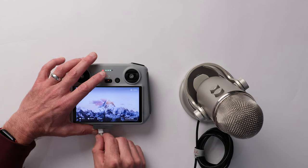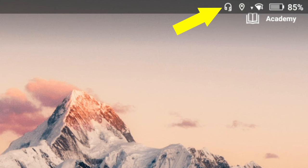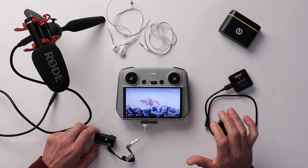The RC remote has a built-in speaker but not a built-in microphone. If you want to add one, all you have to do is plug in a USB mic to the USB-C host port. An icon will appear on the status bar indicating an audio device is connected, and the next time you capture a screen recording, audio will be added automatically. Keep in mind that the microphone function is limited — it will not add audio to video recordings and there is no way to adjust the recording volume. I tested several USB microphones and they all worked fine, although some had very low recording volumes. Mics with manual or auto gain control seem to work the best.